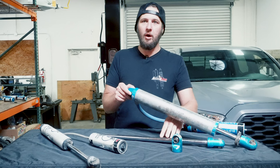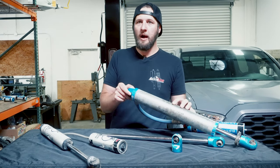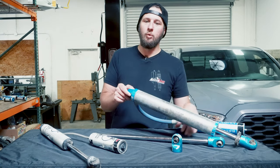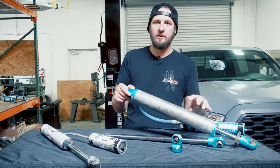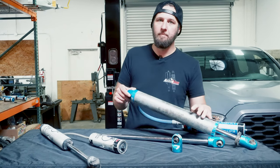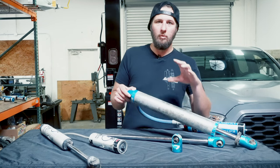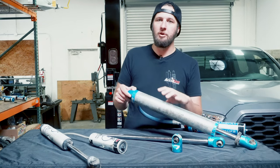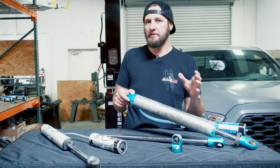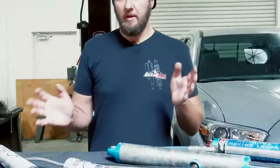On the bodies, you can also use a light-duty automotive wax — nothing that's going to scratch it up, just a real light wax can help keep mud and corrosion off. We've even seen some people in really corrosive environments put heavy-duty grease on them. It makes the shocks look a little ugly, but they do last longer because they're not getting all rusty.